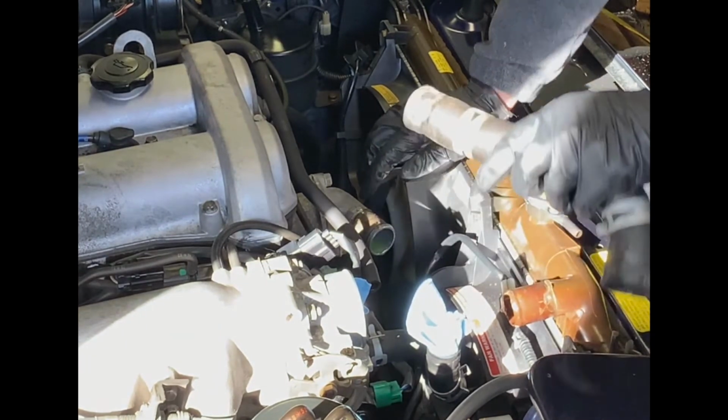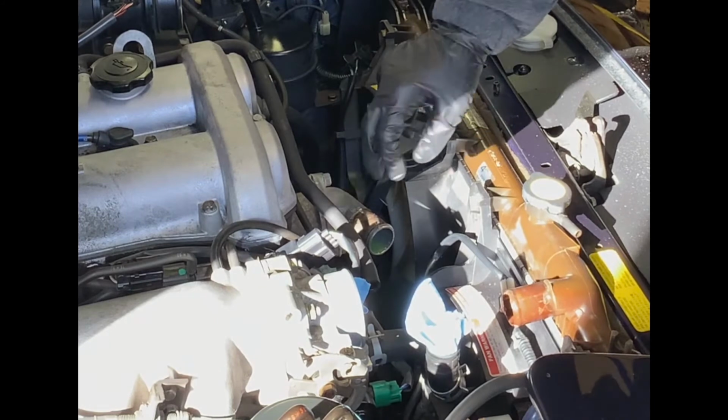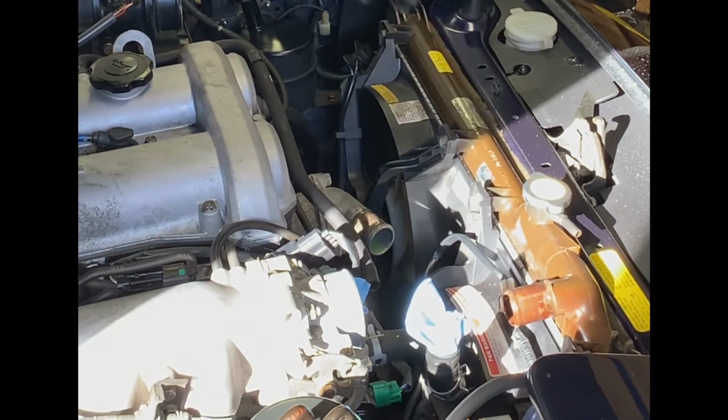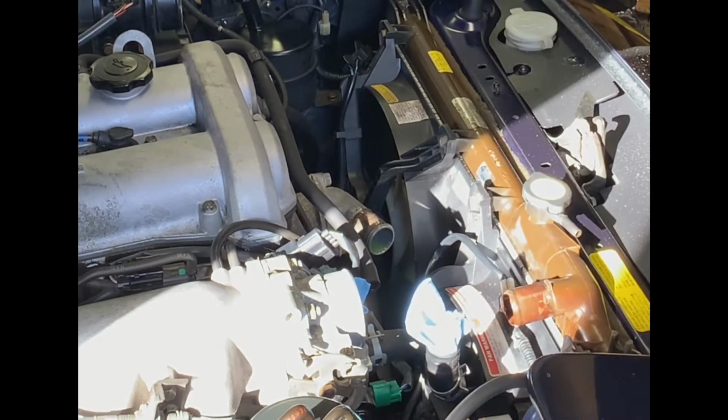And that's a byproduct of what you just saw, the fact that this thing's cold, the valve's shut, and there was coolant that was trapped inside there before we did anything. Because this was lower than this pipe, things didn't flow out when we drained it earlier. But that's not too bad. This hose off, everything out. So we've liberated all the hosing, and we can now go on to disconnecting the electrics.